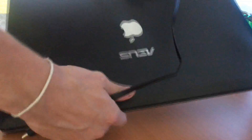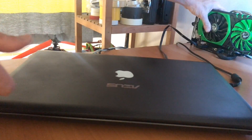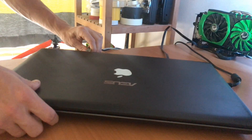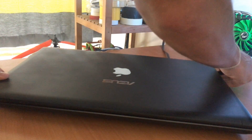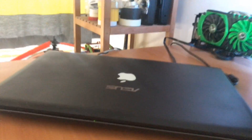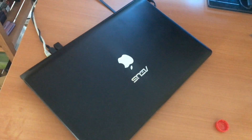I run the mini PCI lead out through the hole and hold it with double-sided tape. Then I just place the laptop down as normal and plug the HDMI into the eGPU's HDMI port. To recap: the mini PCI cable comes out and goes into the HDMI adapter, the power cable goes down to the power brick, a 6-pin goes up into the 8-pin powering the GPU, and an HDMI cable runs to the television.